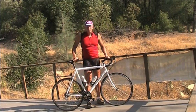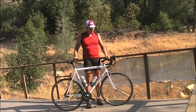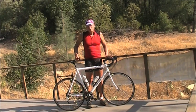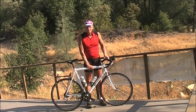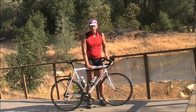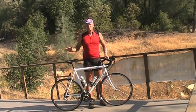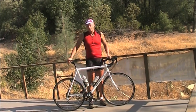The people purchasing a road bike — which I'm going to refer to as a road bike for the rest of the video — can be riding many different kinds of bikes. This bike is considered a race bike mainly because of the angles and the wheelbase. The frame determines pretty much whether it's a race bike, and of course what size tires you put on it. This frame will only accept the smallest amount of tires, so it is a full race frame. At $350 it's weighing in at around 25 pounds, and most people wouldn't want to race on this.